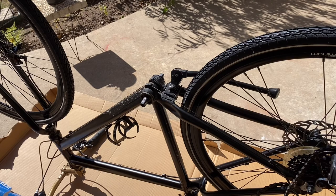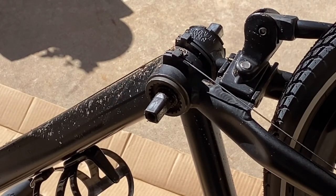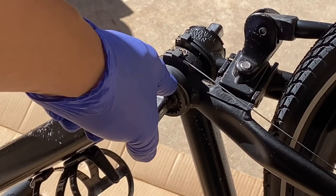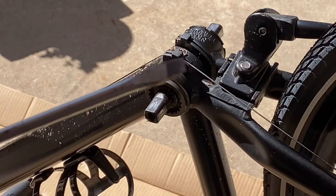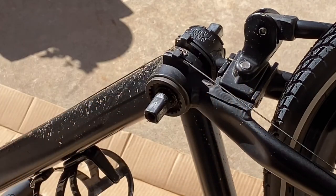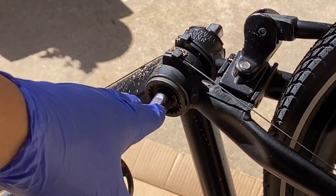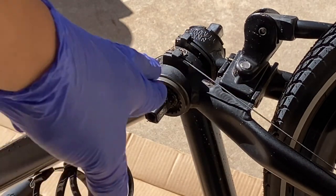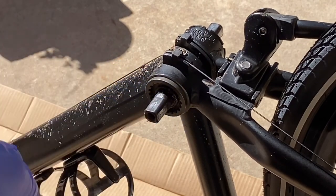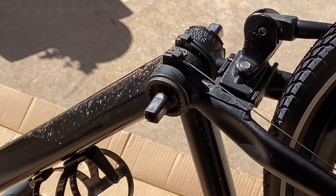I want to mention — I'll zoom in here — I don't have the actual tool needed to take the bottom bracket bearing assembly off, so I'm going to compromise with a flathead screwdriver and a hammer since I couldn't find my mallet. This is an alternative that will only work if you've maintained the bike and lubed the bearings frequently. If you have an older bike where water's gotten in and it's rusted, I highly don't recommend this method — you'll probably end up cracking the assembly. I could have used a monkey wrench but I don't know where mine's at.